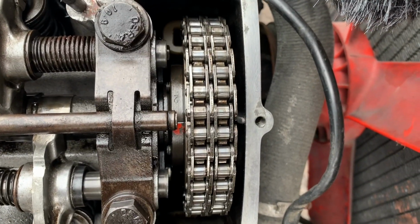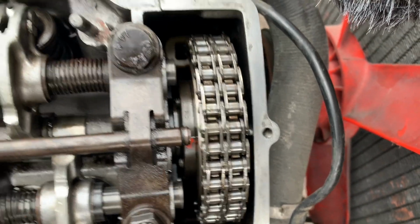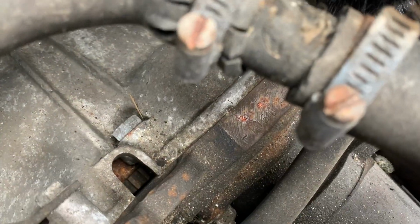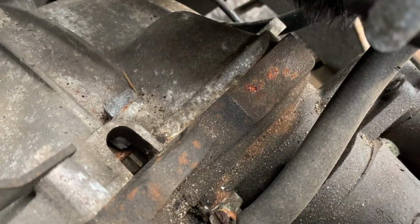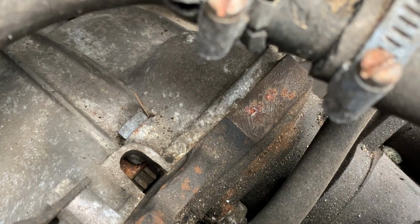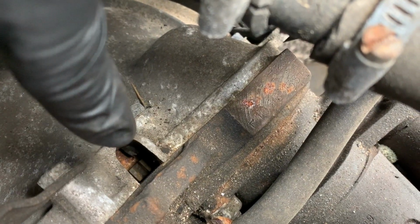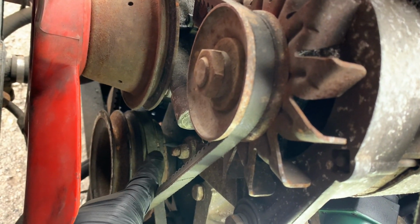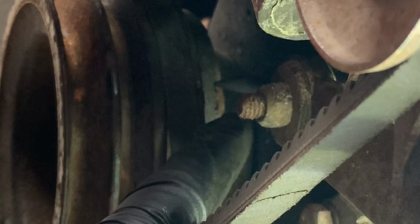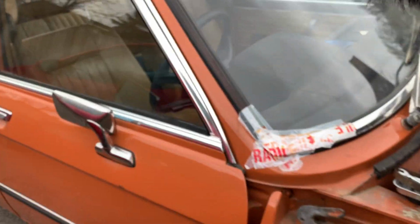So you can see in here that the timing mark on the camshaft matches the center of the oil rail. Also, you can see, although it's a little bit hard to see, there is a mark on the flywheel itself, which matches that mark inside the casing. And the notch on the crank pulley matches with this marking needle. So this means that the engine is at TDC,